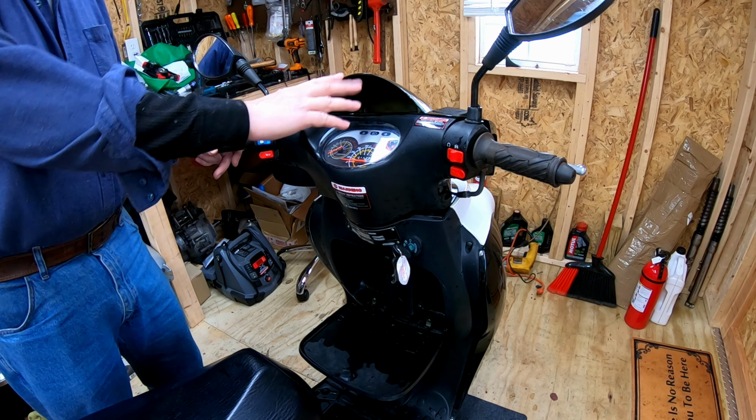So I'll be taking this tub out, the bodywork out. Yeah, we'll find out where that wire goes and find out if that's positive or negative. All right, I got the whole tub off this thing. So if this is positive, which we assume it is because it's red, that runs up here to the starter solenoid. No other wire branches off of it. So that wire is isolated, meaning there has to be another power source, and I'm guessing this is it because this goes right into the harness.